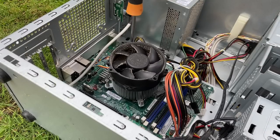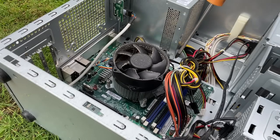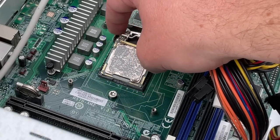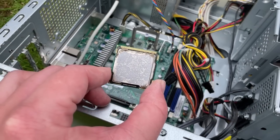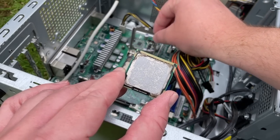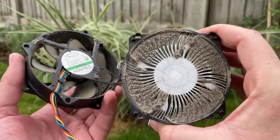The CPU fell into the 'it's okay but a bit outdated' bracket as well. The listing said this one had a first gen Core i5, and I was hoping for maybe a quad-core i5 750. Turns out we actually had an i5 650 — a two-core chip with Hyper-Threading. This was okay back in 2010 for sure, but by 2011 the emergence of quad-core Sandy Bridge i5s ushered in what I like to call a golden age of PC gaming. Socket 1155 brought some of Intel's best and most popular processors, and up until a few years ago a lot of tech channels, myself included, were still recommending them. For the cost of this system the i5 650 may have been solid for the price, but this processor combined with the GT 340 was too little too late.